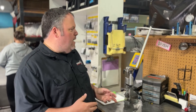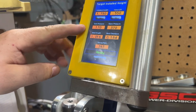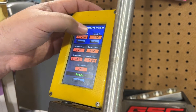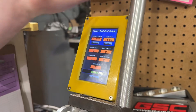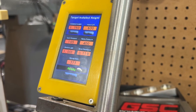This is a boost application and we're going to check spring height. We're going to check the spring at 1750; he has about 550 thousandths of lift. We'll put it in the Buxton spring tester and check what we got. We are 170 on the seat and 370 open — we're pretty far away from coil bind, so we could go with a little more. Our issue is we only put in a 550 lift. Let's change this to a 630 lift — that's what the customer is going to have. There we go: 165 on the seat, 400 open, and 119 thousandths from coil bind.